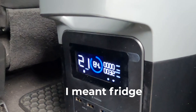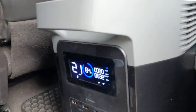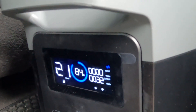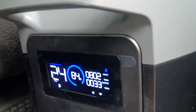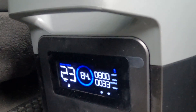The EcoFlow is hooked up and I've got the battery hooked in just to see everything's working. You can see the draw going on and there's the cable going back to the EcoFlow alternator charger. Let's start the car - proof is in the pudding. She's starting to ramp up: 800, 801, 802 watts - all charging, all good. If you have any questions regarding the EcoFlow alternator charger or EcoFlow products, just drop a comment. Thanks, bye.